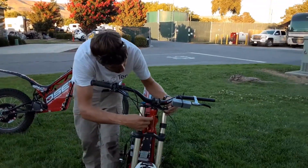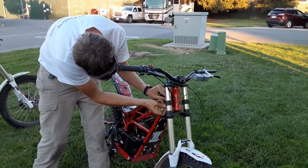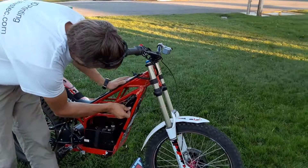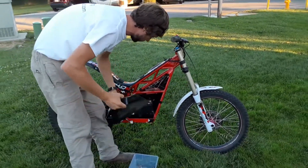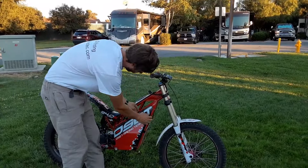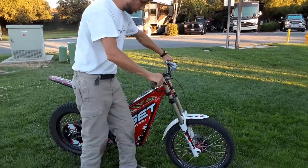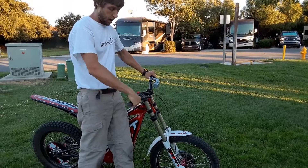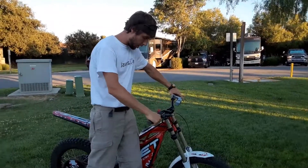We can tuck this up a little bit and use one zip tie just to tuck it up right here so it doesn't drag. This box can just stay right here, tucked out of the way. I'm going to go ahead and turn the battery box on. There we go — I still have full charge and the bike still operates as normal. If I pull the clutch in, no response. I can get full throttle and you can see I can modulate that clutch. I'm going to go ahead and install the grip, install the cover, and go for a ride.